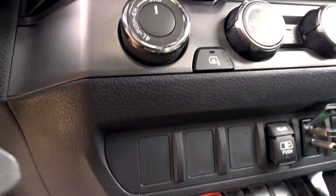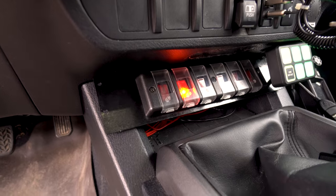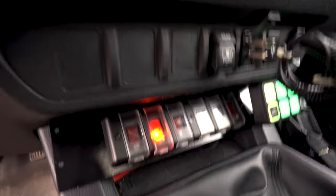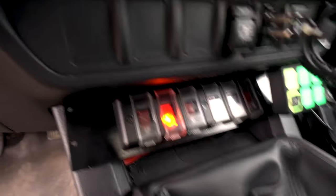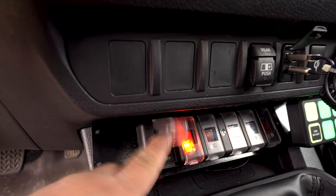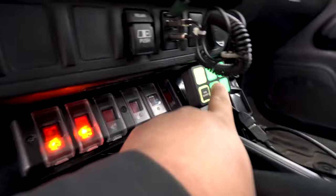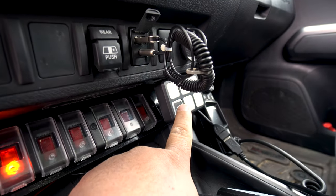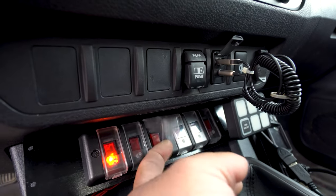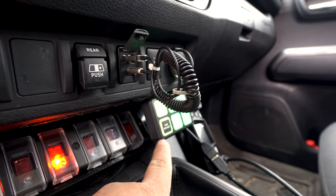We'll demo ignition 12. So keys in, ignition 12 is on. Ignition 12 is hot, which will allow us to turn on the other half of the grid, basically. The other half will be this one. This is main power. Main power is on. So main power is on, lithium power is on. Currently, it's still on lithium power, so let's just shut that off. So it's off, right? Divert power, override. It's overridden. Power is now coming from the truck and not the lithium.